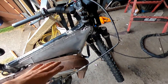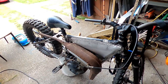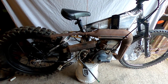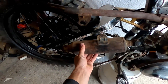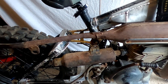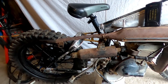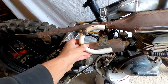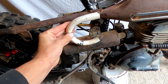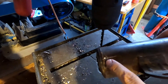I'm pretty happy with that - this sticks out a little bit but if you're riding on it it's not so bad. I've been at this for a while trying to figure out where to put the muffler - I was going to put it sort of down here but there's a big gap right here. The other problem is I think that this pipe length matters on a two-stroke for the expansion chamber to work properly. I've made this setup so it's going to loop around and go back in. I'll blank this hole off here and drill another hole here.